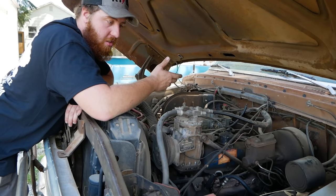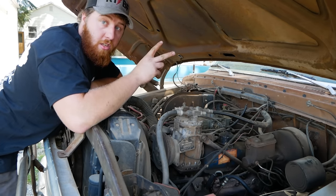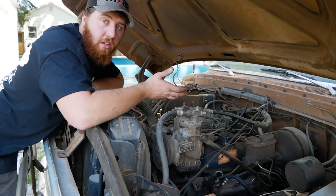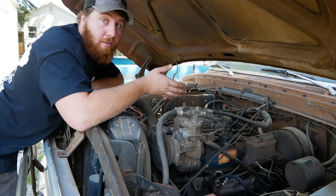Never mind. Before we do any actual long road trips with vehicles we revive, I'll always crawl underneath and check the transmission level and the differential level. It takes 10 minutes to check both of those. Costs you $4 in liquid to fill them because they're usually pretty much full. But it will save you having to replace a trans or a rear axle if they're empty.